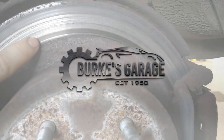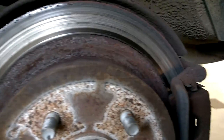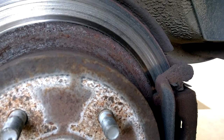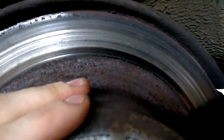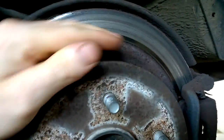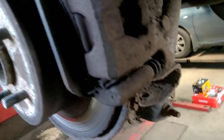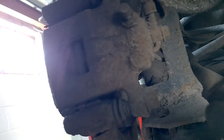The first thing you can see is steel on steel on the disc — that is from the outer pad. On the other side the pads aren't half as bad. It has locked on pretty much, or it's very difficult to turn, just completely jammed, so this caliper needs to be replaced.